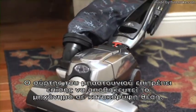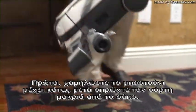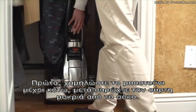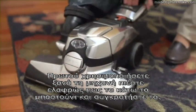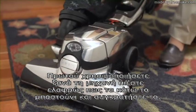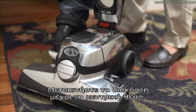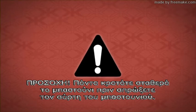The tilt latch also allows the unit to be stored in a vertical position. First, lower the handle all the way down, then move the tilt latch away from the bag. Before using the unit again, press down slightly and hold onto the handle. Move the tilt latch to the center position. Caution: firmly grasp the handle before unlocking the handle tilt latch lever.